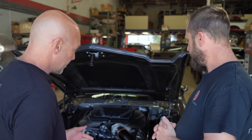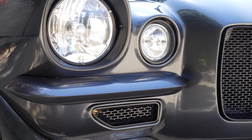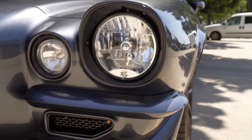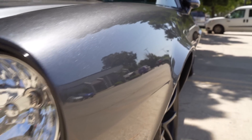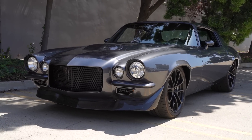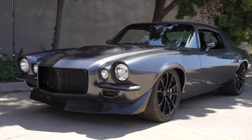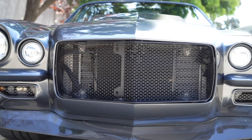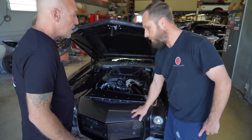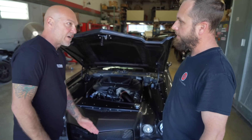One of your signatures is flushing your bumpers, tucking them way back, and sharpening all the lines — which a lot of people wouldn't notice until they see it sitting next to a stock one. Then all of a sudden all your arches, everything's so sharp. There's a ton of bodywork in this car. The whole front end is one piece — there are no seams in anything. The bumpers are really tight. The grill opening on this car would have carried a rubber nose, so all of this is fabricated out of steel.